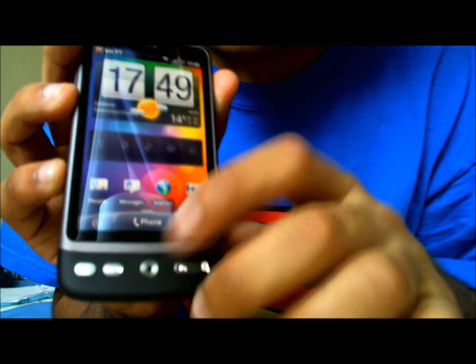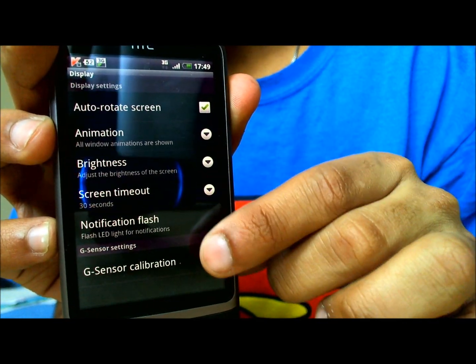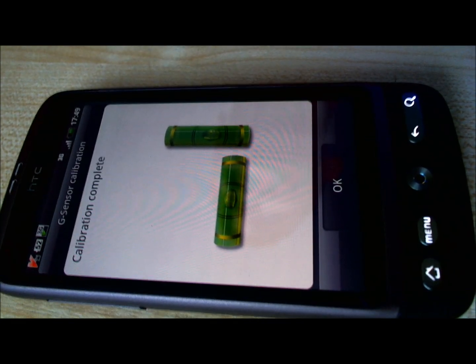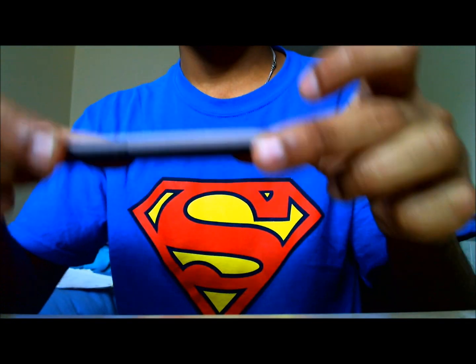So if I go to menu again, go into settings, go to display, and now I'm going to show you — keeping that auto-rotate function on if you want it on — go to G-sensor calibration. Now, if you place the phone flat, parallel to the surface, like that, and you press the calibrate button — it's on a level surface, I can assure you this surface is level — as you can see, the little bubbles are calibrated. It is calibrated. This is the correct way of doing it: placing it flat so that the back or the bottom face is against the surface, not sideways. Do not place it sideways like you would with a normal leveler, because it will not work.